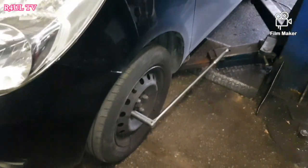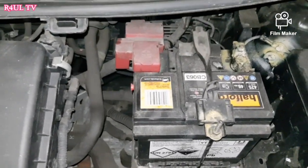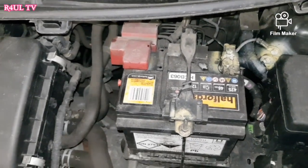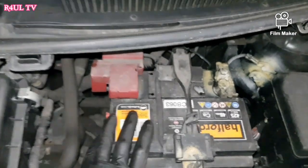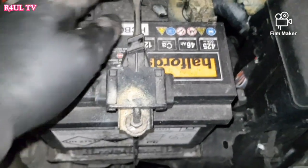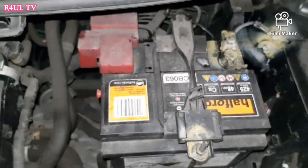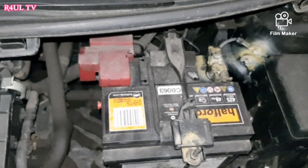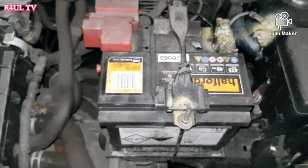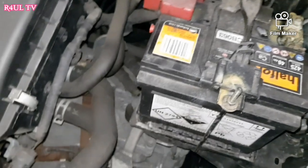The first thing we're going to do is take the battery lead off. Obviously crack the wheel nuts like I mentioned, then take the battery leads off and the battery bracket off — 10 milli bolts on the battery leads. Before you take them off, ask the customer if the stereo is coded. If it isn't coded, happy days. If it's coded, you might need a code for it. After we take that off we can gain access to everything.